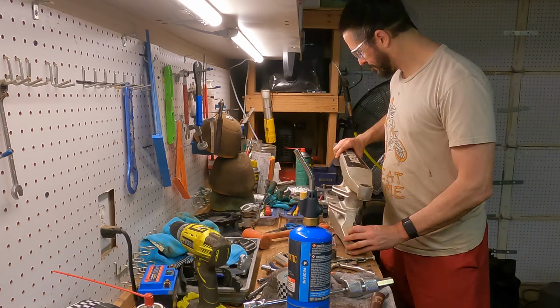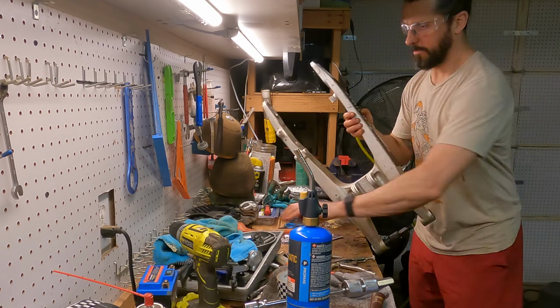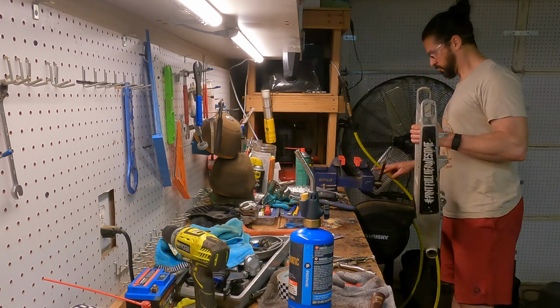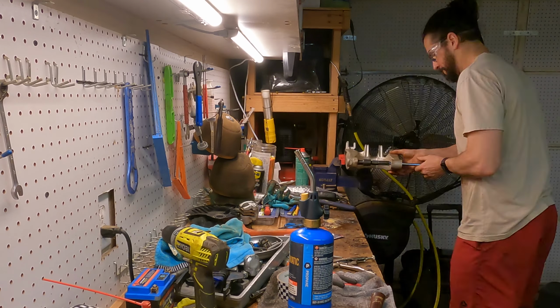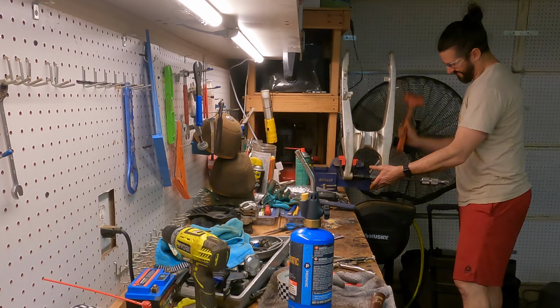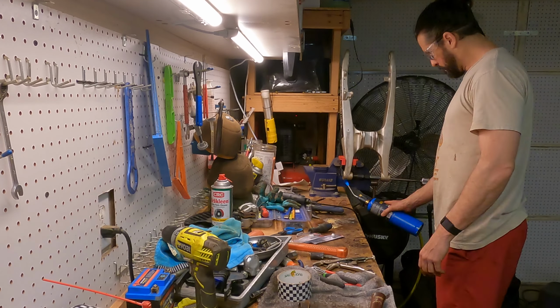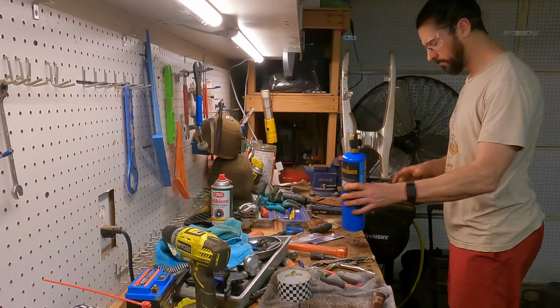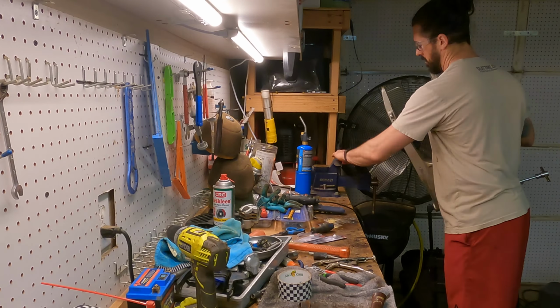It took me to a new tool, the slide hammer bearing puller, or to some, a blind bearing puller. You mount the correct size collet in the inside of the bearing, creating the grabbing force you need to drive the bearing out. You then attach the slide hammer to the mounted collet, secure your hardware, and hammer away. Though I learned how to use a new tool, I need to remember greasing your bearing is truly step number one. I'm not excited about this.